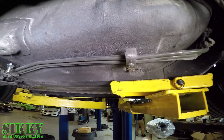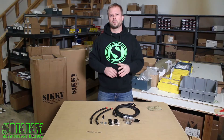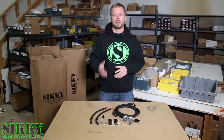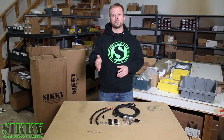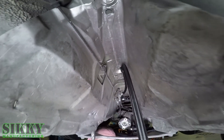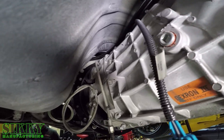The way the factory FD hard lines are routed along the chassis often creates a tight spot where they come up along the firewall, which interferes with a lot of different engine swaps on this chassis. The advantage of this kit is that the line routes up through the transmission tunnel, completely eliminating the possibility of overheating a fuel line next to one of the headers, downpipes, or manifolds.